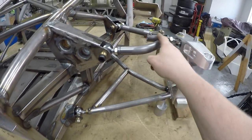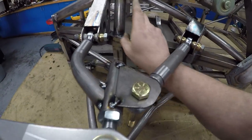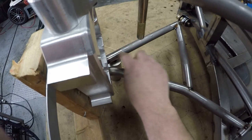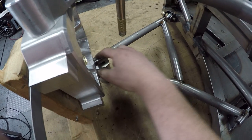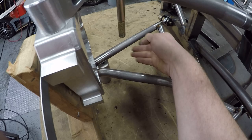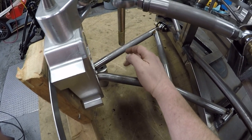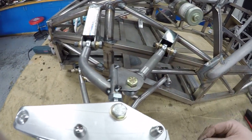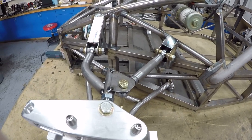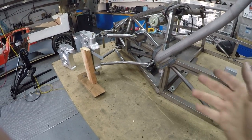I've got a web to build here and a web to build there. We'll build a piece here obviously because the shock absorber needs to mount from it. The shock absorber is going to sit up through here and come down, sitting relatively further to the back than the front. Because it's a shock mount taking lots of load, instead of just using 1.2mm we'll use a 3mm plate for the top and then down, with the bottom piece being a thinner 1.5mm. The top piece that spreads the load will be bent to give it structure both ways. We'll use 3mm to make sure it doesn't bend with the shocks. Then I'll build a shock tower here, but not until I know exactly the lengths of the shocks — that's all dependent on which shock we use. So the shock tower goes in last, once I know the fully open and fully closed lengths.